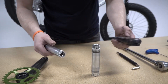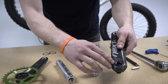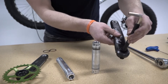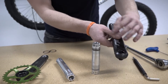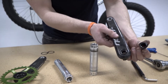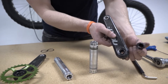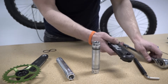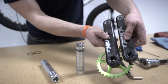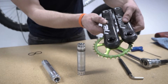Next step is to install our new spindle into our crank arm. At this point you have a choice: you can leave the current setup in the non-drive arm — a crank bolt that uses an 8mm key with a puller cap, which is a self-extracting feature — or you can choose to go back to your non-puller crank bolt to save a little bit of weight. Both the non-drive and drive side cranks can have self-extracting crank bolt assemblies installed, which is the easiest setup if you plan on changing your spindle regularly.